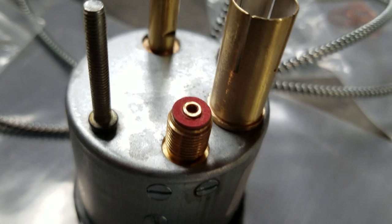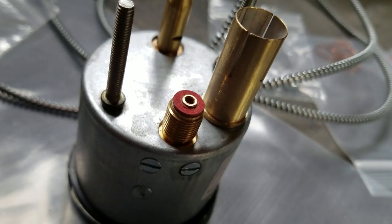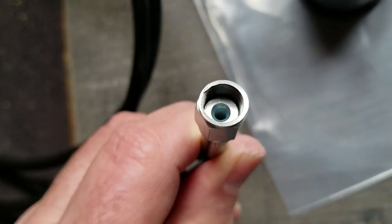This little red washer goes right on the tip there of the outlet and that fits into the end of the hose. There is not a hole big enough to allow the capillary tube with the big nut attached to the end of it to fit through the firewall, so I basically used a Dremel tool to go ahead and cut a little bit of a hole in the firewall.